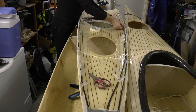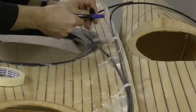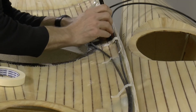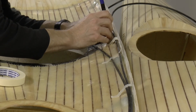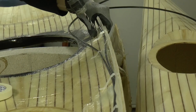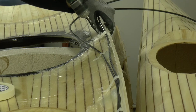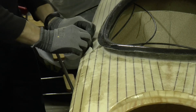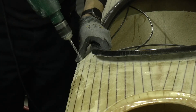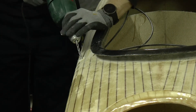With tape I temporarily lay out the tube. I want the lines to disturb the packing of the kayak as little as possible, so I place them along the deck line. The control line for raising the rudder needs to pass the deck once more — I want to have it on the back left side of the cockpit. It will look something like this when ready. Also here I angled the through hole.